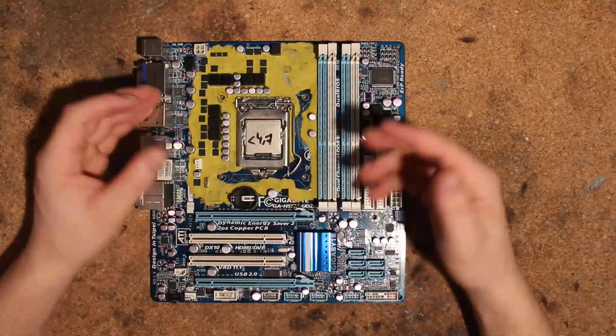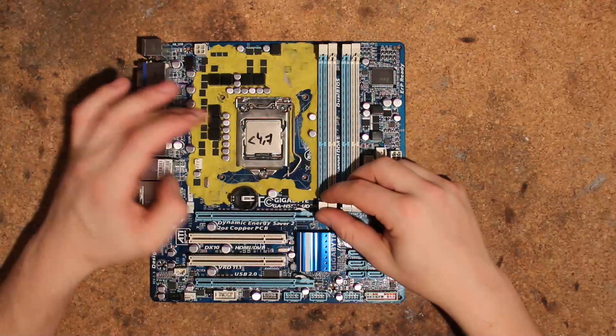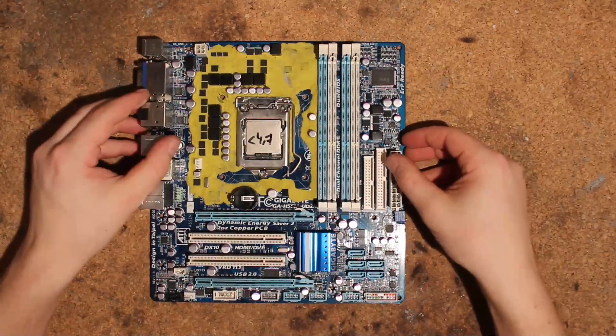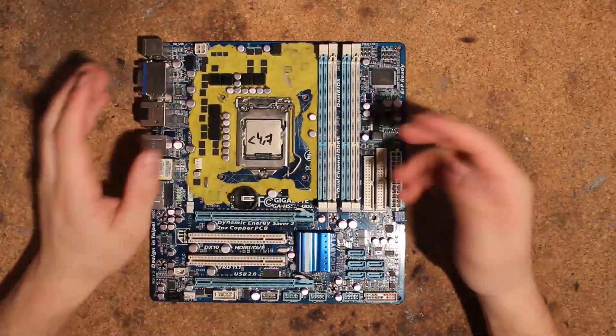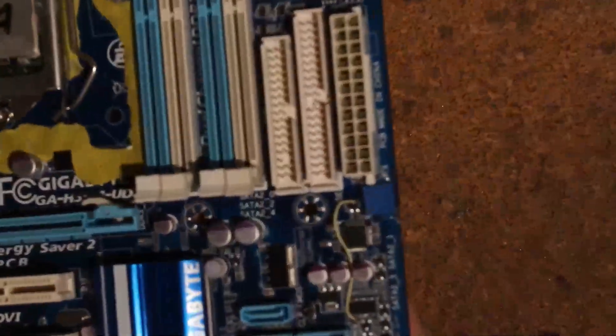This is typically the cold bug mod. I'm not sure which pin on the CPU it is right now, but basically the universal solution would be to look for a 750 ohm resistor close to the socket. This is the typical mod, and the second one I have here is the VPLL mod.